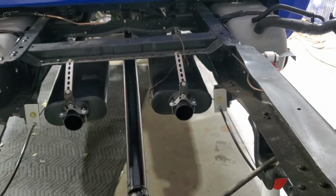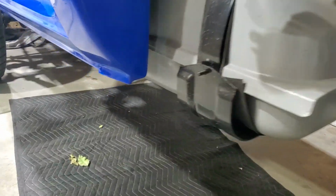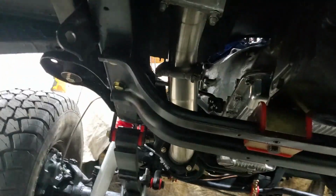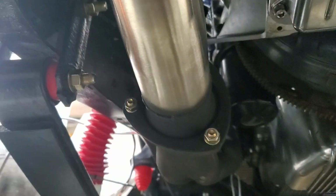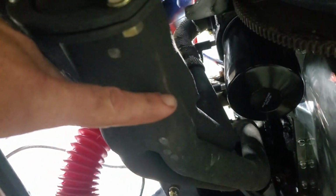I did want to retain the dual pipes all the way out, partially just because that looks cool, but it also helps with the flow. And since it came with some headers that we've revitalized and fit under here, it worked out pretty well. Our work was not bad. We reused the flange that was on the old exhaust pipe. It's cut here, and so this piece is the original flange tied to the original header that's been painted in exhaust high temperature black paint, just a rattle can, and then tied into the stainless steel.